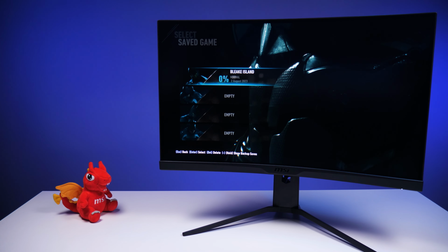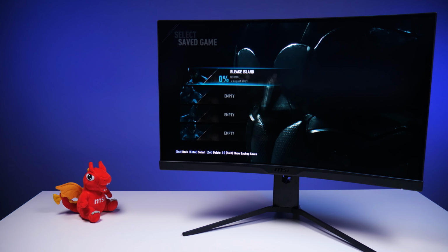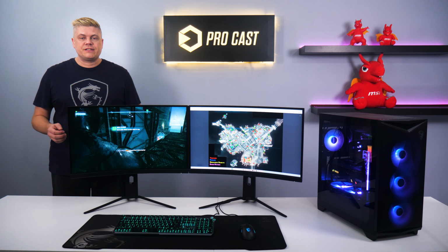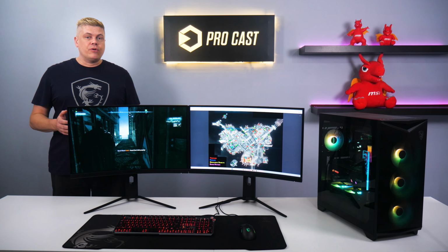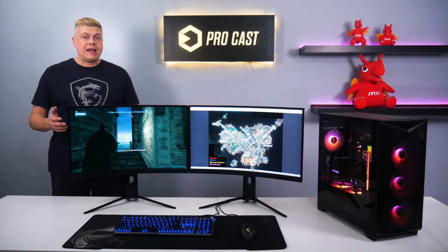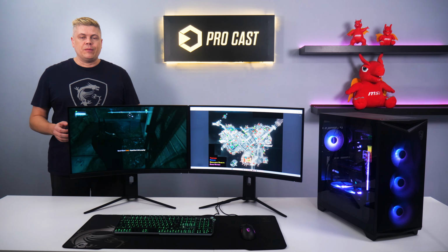Connecting with HDMI or DisplayPort, if you're having trouble reaching high frame rates, have repeating dropouts, or pixel shimmering, or don't see a picture, there's various possible reasons. From incorrect or loose display connections, one link in the output cable input chain, as mentioned, or it's possible your cable may be outdated or damaged. Try testing with a new DisplayPort cable.